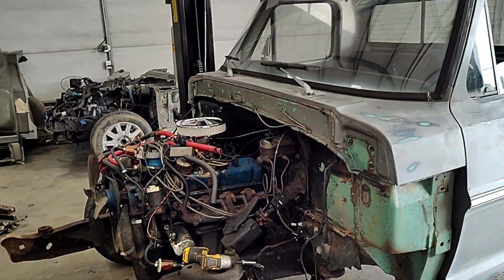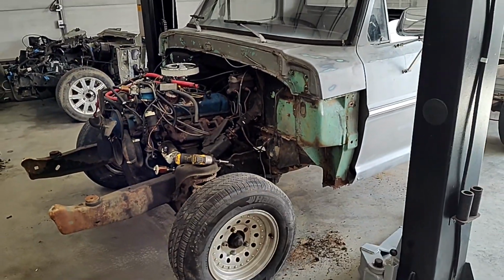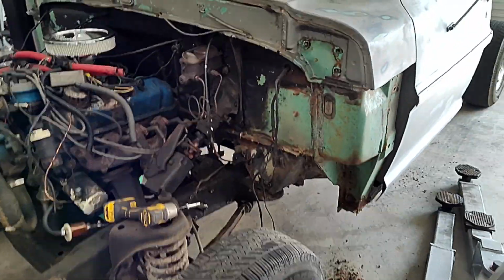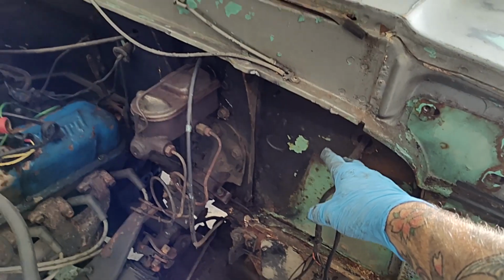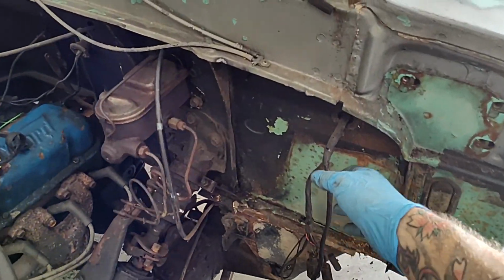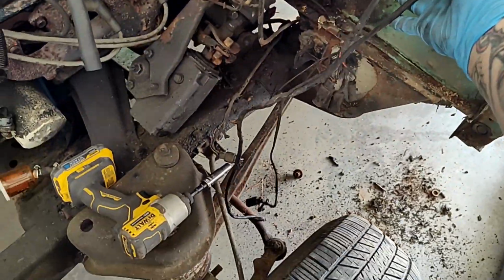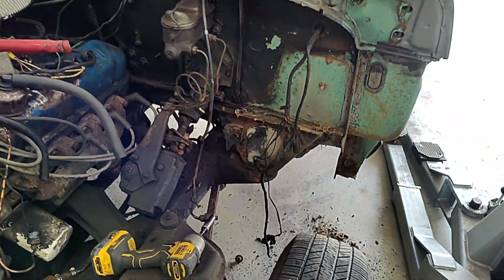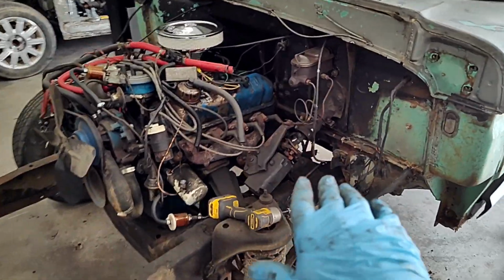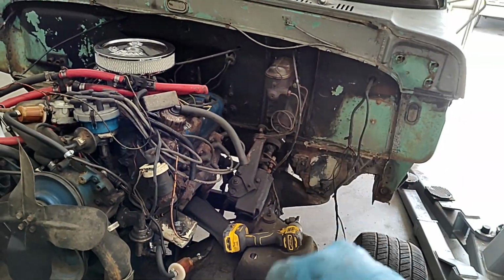It's the next day here, and we've started stripping on this wiring already. I forgot to record some of it, so I had to jump in now. But anyway, all I'm doing here is disconnecting everything that's connected to the firewall in this cab from the frame. There was a wiring harness that came here, and I've got it all unplugged. Pretty simple stuff. If you guys are doing this job, I'm sure you can figure all this out. Just follow the wires and unplug everything.